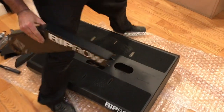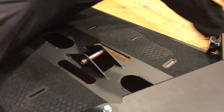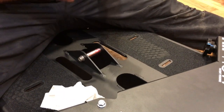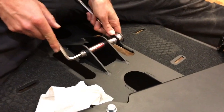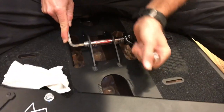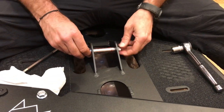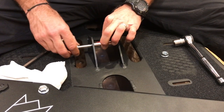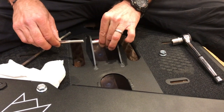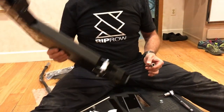Here's how I do it. I hope you've been stretching so you can straddle. Here goes the bubble wrap. You're going to use an 8mm Allen key and a 15mm socket, or a 15mm wrench, or maybe just a pair of vice grips, that's fine. Remove the main pivot bolt. Here's the nut, hang on to the steel sleeve, and here's the bolt with a washer under the head. Leave the grease on the sleeve, and just slide it.